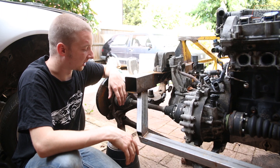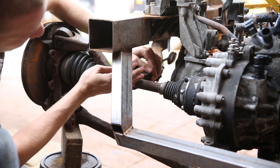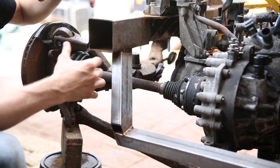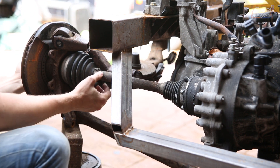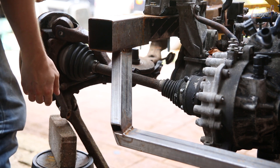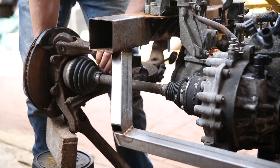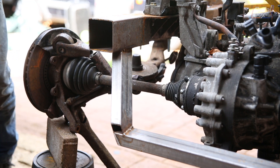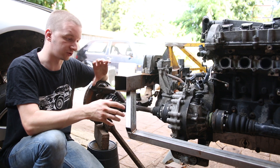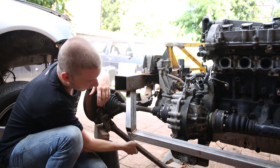A few factors combine to give us a really hard time. The main one is just congestion — it's a busy area. We've got our drive shaft in the way, our coil spring mount, and the chassis leg all in this area. When building the upper control arm we have to figure out how it will mesh with other components through compression, and there are so many possible track positions and camber settings. We've got too many constraints to reason about the upper radius arm design, so we're going to do the lower arms first.